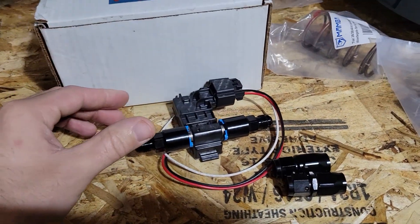I don't know if I need the water methanol if I'm gonna be running E85, and I'd like to keep things as simple as possible. We'll leave the water methanol installed and see how things go — see if my intake air temps get up high or not. I have a decent intercooler and I'm not running a ton of boost anyway. If we don't really need the water methanol, I'll pull it off and sell it or keep it for another project.